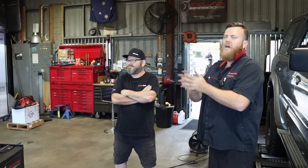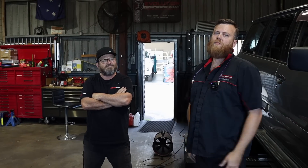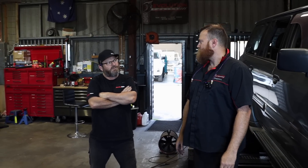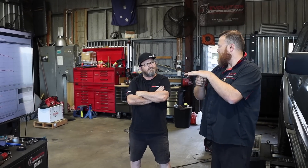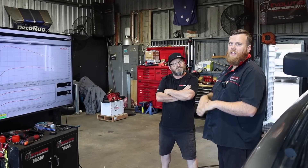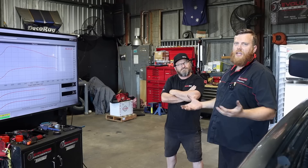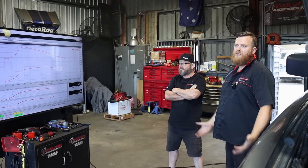Now we'll go into the compensator and see if there's a little bit of room to move so we can tweak it up a little bit more and see how it reacts to our changes. We'll go inside and see if there are any shim stacks in there that are actually limiting how much travel the fuel pin — the compensator pin — has. If we've got some stacks in there that we can take out, we can let the fuel pin travel down a little bit further and see if it wants to inject a bit more fuel. Every pump's kind of different — sometimes they respond, sometimes they don't, so we just need to get a baseline, make some changes, and see how it responds.